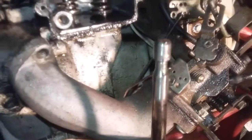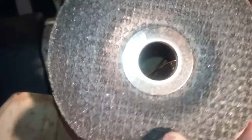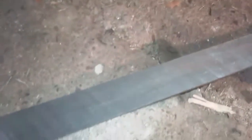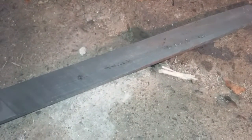Now the end of this needs to be ground down to twelve thousandths of an inch. Because it's something so precise, you can use a circular grinder with a wheel, but this moves fast and digs fast. So to be more precise, I'm going to use a regular file — just go along it back and forth. I'll probably do that for a minute, then wipe it down to make sure no shavings go back into the machine because that could cause unnecessary wear.